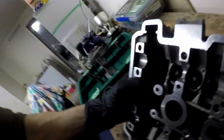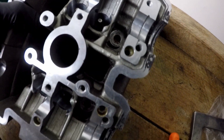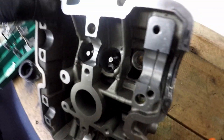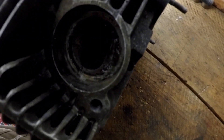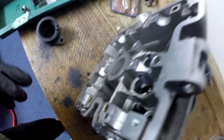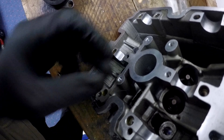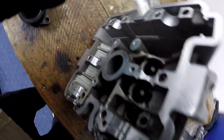Put it back on the race bike. As you can see looking down there, my two exhaust valve stems are still in there, and that's because without the springs in there, they don't want to come out. They have seized. I'll go get a hammer and something soft to protect the top of the valve stem so I don't damage it, because I want to reuse them.